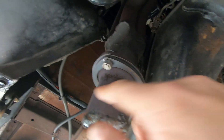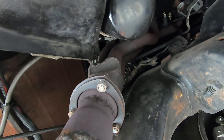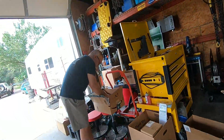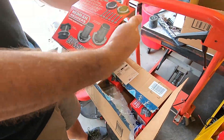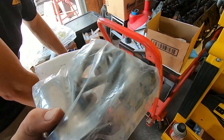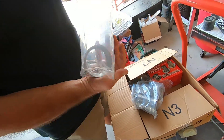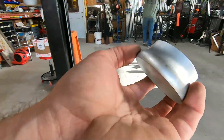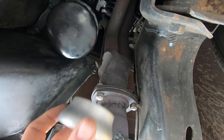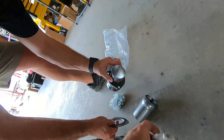The whole reason for this exhaust work is a common old-school problem: bent collector flanges causing leakage all around the gasket — you can actually wiggle the gasket. The solution is to go to ball-and-socket flanges. The plan is shorty ball flanges because the pipe needs to make a pretty quick turn. They'll cut the collector off and weld the new flange on, with the socket going on next.